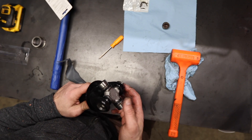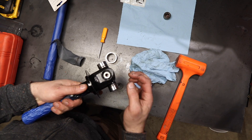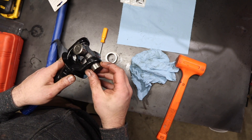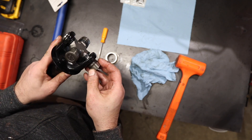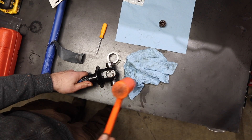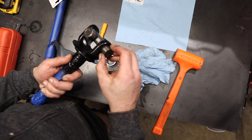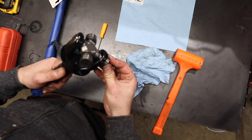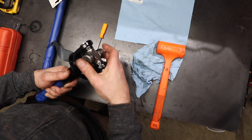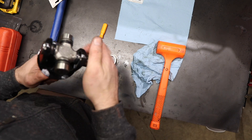If it's rolling, chances are it went in okay. So that's almost there — still spins freely, great. Now this is far enough up that you can carefully get the needle bearings in there. That's almost as far as you can go before you really need to give it the good stuff. Now I'm going to put this on here and give it a tap. Does it spin? It spins — that's a good sign that your needles are okay.